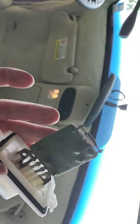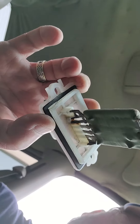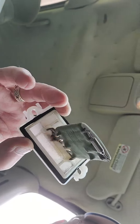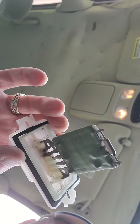The other thing I figured at the same time was to take the resistor out — the speed controller resistor. When I took that out it was also bad. If you look at that you can see it's melted, so that was probably one of the reasons that gray smoke came onto the dash.